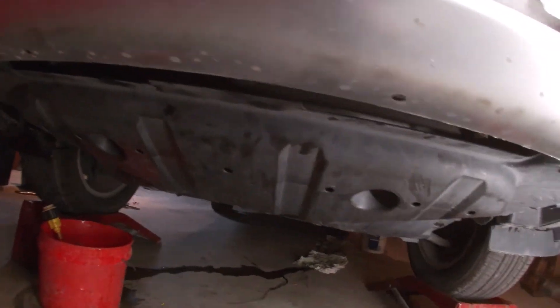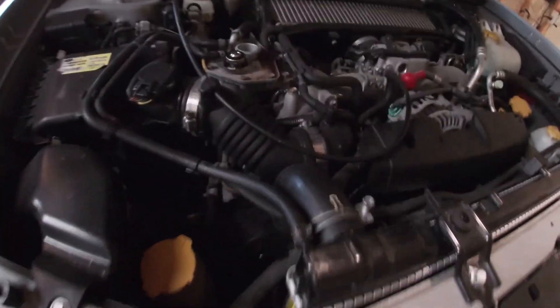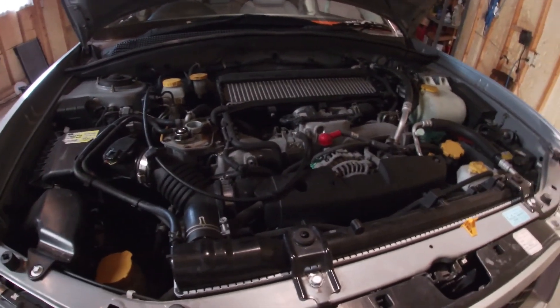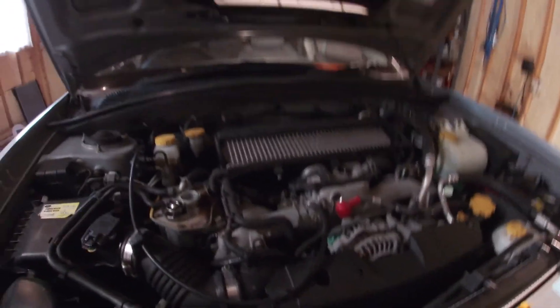I've got my shield back on and a big mess underneath the car to clean up. What's left to do: fill the cooling system, tighten the radiator drain plug — which is already tightened — top up and fill the system, run the vehicle for five to ten minutes, and check for any leaks underneath. Here's a tip: do not plug in the block heater with no coolant in the engine — you will burn out the block heater almost instantly because it gets so hot so quickly.